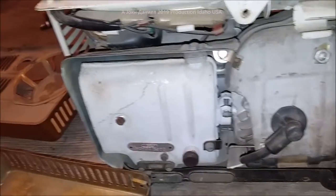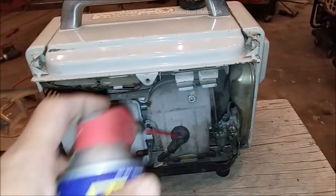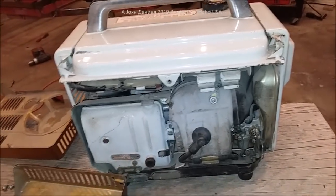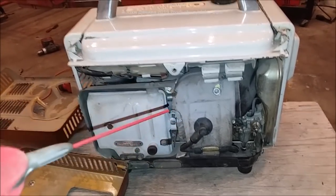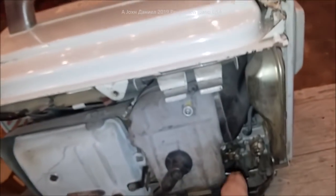I pulled the plug — this is integrated, like those little two-cycle engines but this is actually four-cycle. Apparently the previous owner couldn't start it because the whole cylinder was full of gas and he just gave up. We went in and looked it over — I took my bore scope and looked inside, the cylinder looks great. Compression was great at 74 pounds, which is really good. I think it's about a 25 or 30 cc engine — it's not very big; you can see the head right there, really tiny.